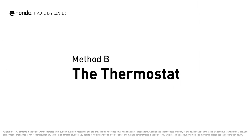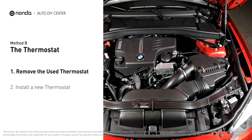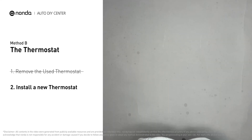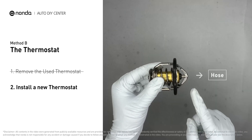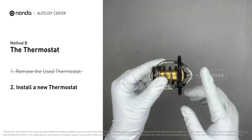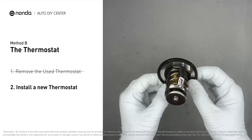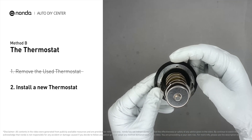Method B: the thermostat. In most cars, the thermostat is placed near the water pump on the cylinder head. First, carefully remove the thermostat from the engine — the engine has to be cooled before attempting the process. Then install a new thermostat. To install it correctly, make sure the short end goes toward the hose and the deep end goes towards the engine. When you install it back, make sure the jiggle valve is pointed straight up to the top of the engine so the air can get through the system.